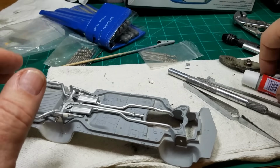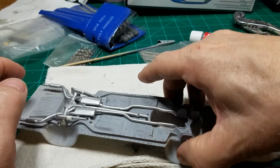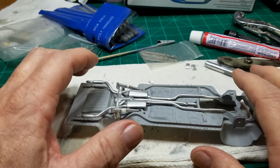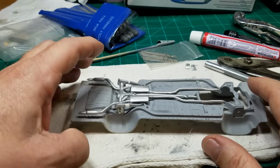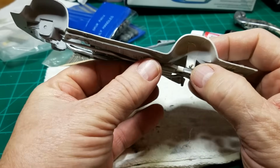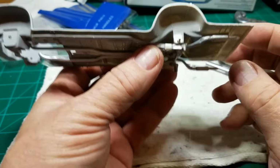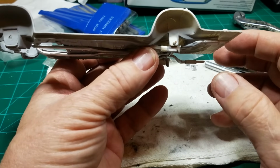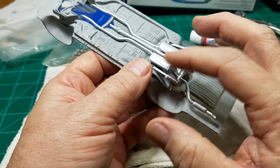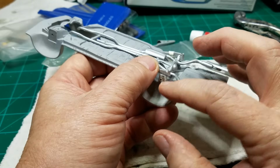All right fellas, I had mentioned previously that I was going to put these extensions on the rear axle, and after doing so I looked at this and decided that it just jacked that rear end up too far. So what I've decided to do is take those back off, and I re-drilled the holes lower than the original holes. So it does lift the back end just ever so slightly, but not as high as those extensions did. In doing so, I discovered that the control arms here no longer reach the alignment pins, nor did the axle sit down on those blocks correctly.